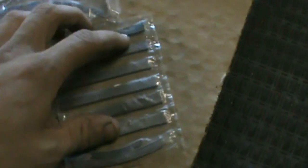And these Apex seals I got from my buddy. He bought them with some car, but they're old school Rotary Aviation seals. You can see they come with springs, but I got some RA Racing springs, so they're a stiffer spring. I think it's a higher nickel content. These are the classics, just the older style. These ones are even numbered, so they're matched. The newer ones aren't matched, so you can just use any corner piece, but either way they'll still work pretty good for $100 too.